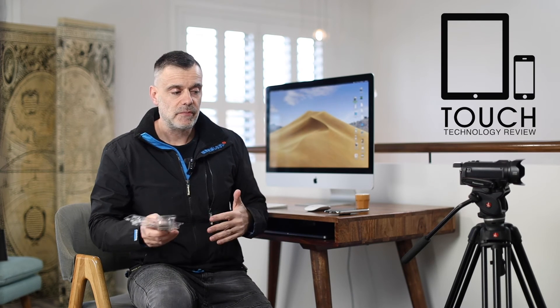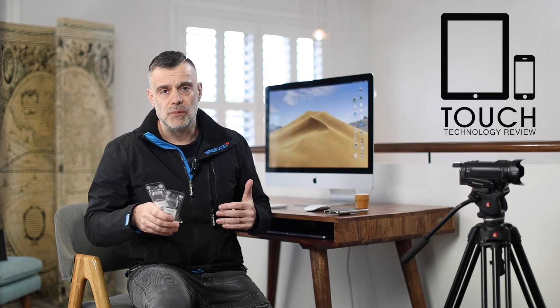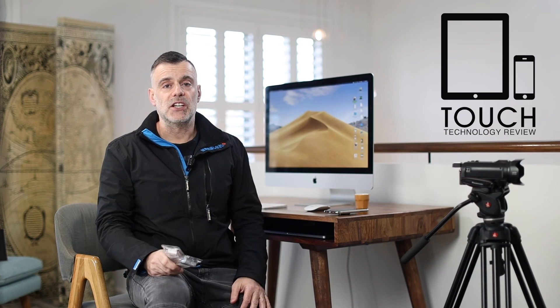In general, the principles I've shown you today apply to all previous generations of iMac for the past five or six years that were expandable. Quite a few models were, though not all, so it won't apply to everybody. But in general the best thing to do is stick to one RAM manufacturer, install it in every second slot, make sure you're pairing the RAM in twos, and you're going to get the best performance out of the machine. Hopefully this information was helpful.